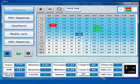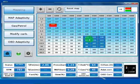But these maps are calculated from a series of tests that we made, so usually they are quite near to the optimal map, but not every time. So sometimes you need to make a little bit of adjustment. To change the values of the map, you have different ways. You can select the parts that you need to change and increase the values, and as you increase the values, you increase the amount of gas that you give in the region you have selected.